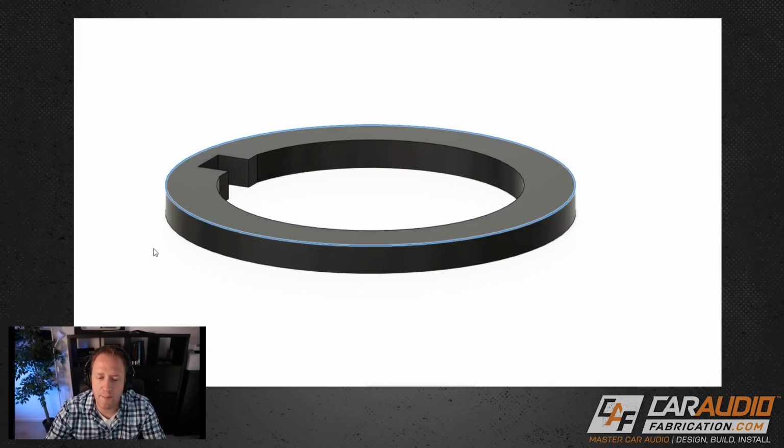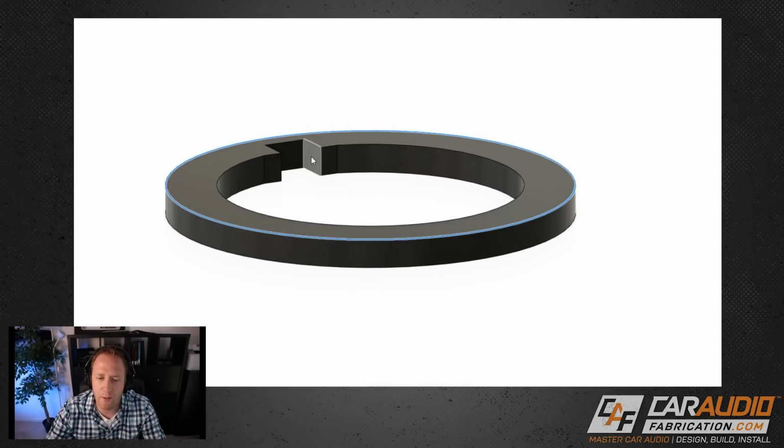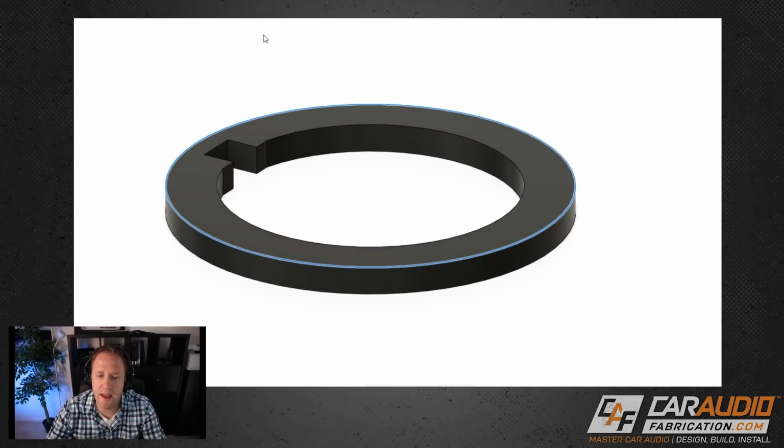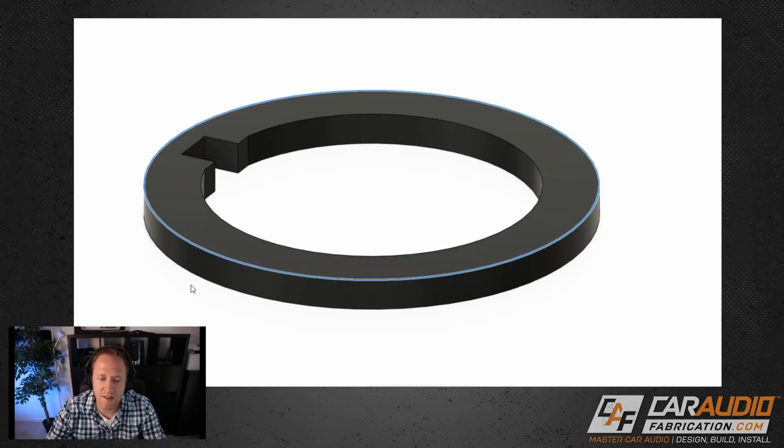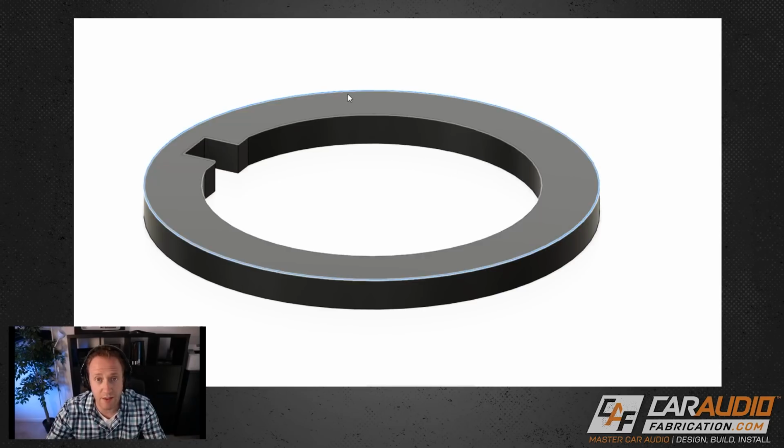The plan is I'm going to have a part from the back side that locates on this key location, that way it can't rotate. And then I'm going to have a part that comes in from the other side. And basically when we put our knob through here, when we put that threaded clear section through and then add the black nut that tightens everything together, it's going to sandwich my bottom piece, the factory panel and my top piece all together, holding everything in place.